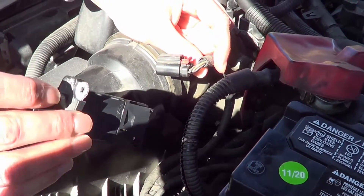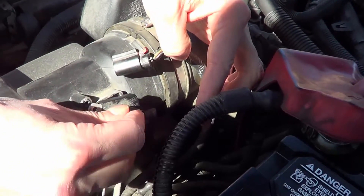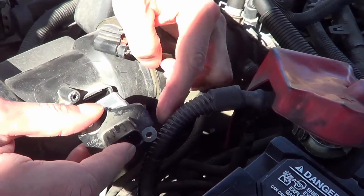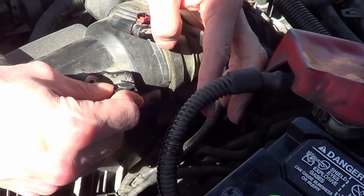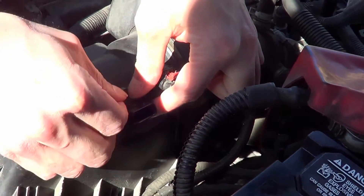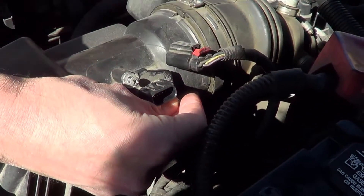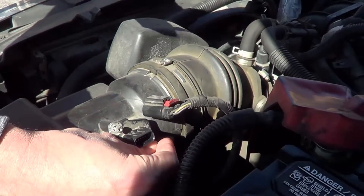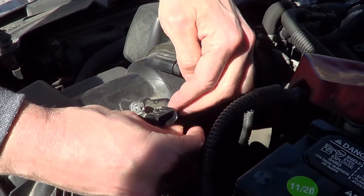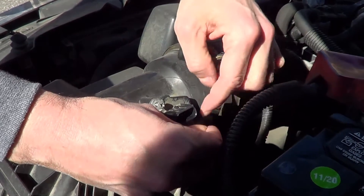I've actually waited a couple of hours here. There's only one way this sensor can go in — you won't be able to slide it in the wrong way; the shiny part is obviously above. Slide it in and tighten it up. The mass airflow sensor also measures the air temperature coming into the engine, so it actually serves two purposes — measuring airflow and air temperature — helping the computer dictate how much air and fuel should be burning inside the engine.